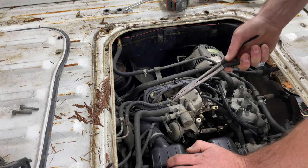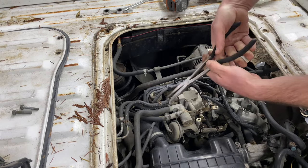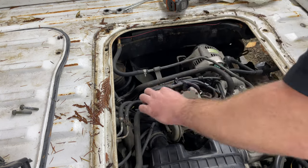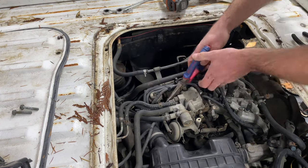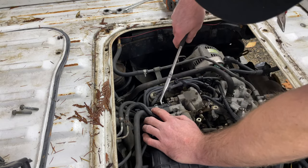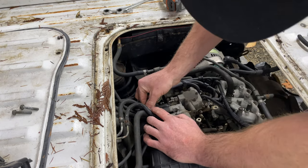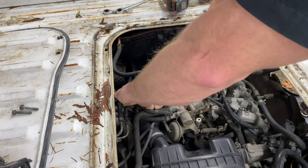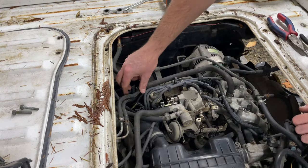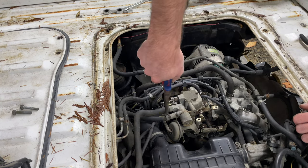Be careful around all your vacuum lines and fuel lines. You'll hear a click when the fuel line breaks free — listen for that click — and then you should be able to get it off. A little bit of fuel came out; that's okay. So we've got our fuel lines off. Now we can take our air solenoid recycled-air line off.